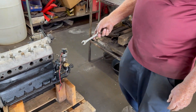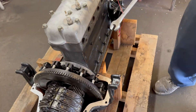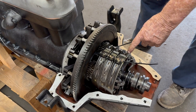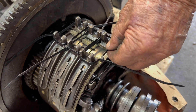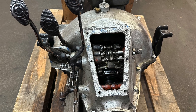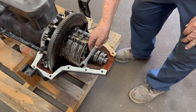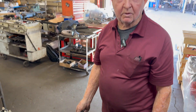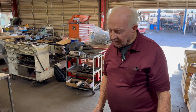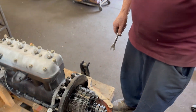So we get over to the motor — we got that pretty well all assembled, and it's into the transmission. Here are the three bands. What we're going to do is just use plastic zip ties to hold them together, loose enough that we can set that on there because it has an open cover. We'll put all these together and make sure it's okay, put a little silicone around here. When they made this, they didn't have silicone or zip ties — they had a special tool for that, but I don't have it.